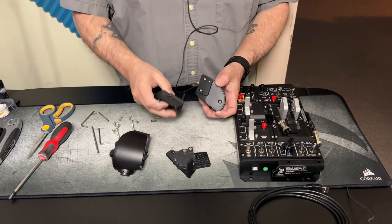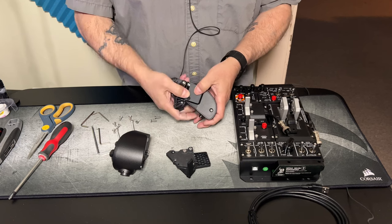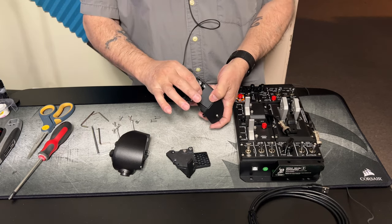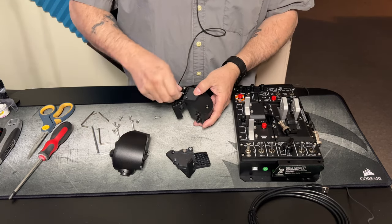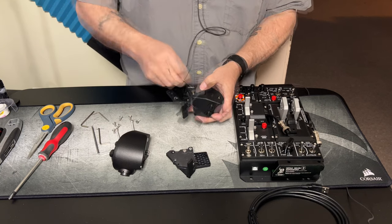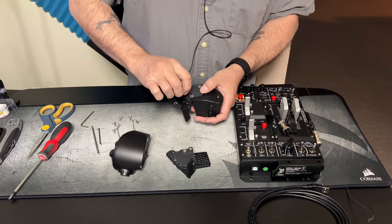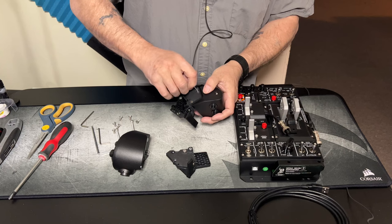This one's going to go on this way — yeah, that's it — and then your throttle cable is going to go on the inside. Put these back in. Once you get them snug I wouldn't recommend going crazy with the tightening — give them a little quarter turn.